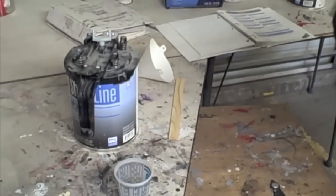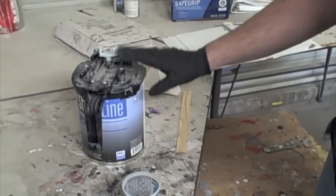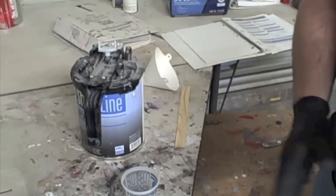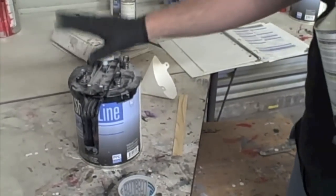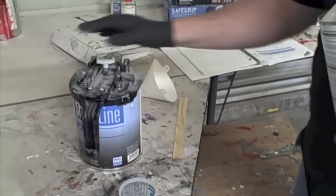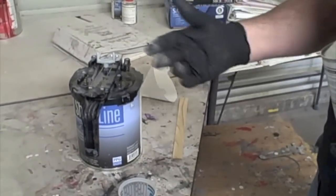For this job we're going to put on two coats of this. Another thing about epoxy is it has about a 72-hour window where you can come back and spray your base coat, surfacer, or whatever you're putting on top. A lot of products are just 24 hours, but with ShopLine or the PPG line you have that 72-hour window.